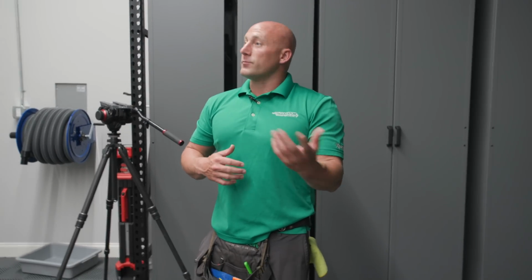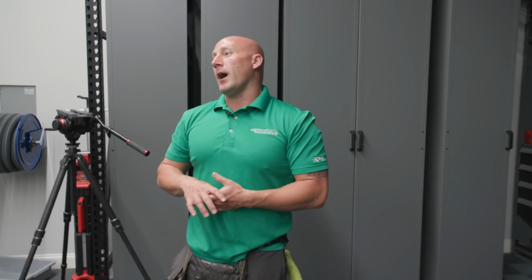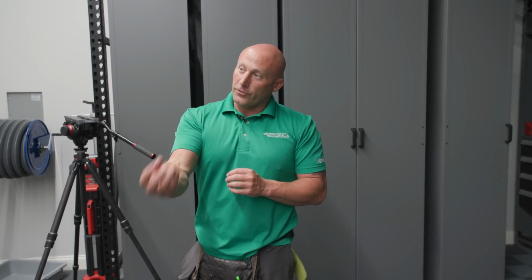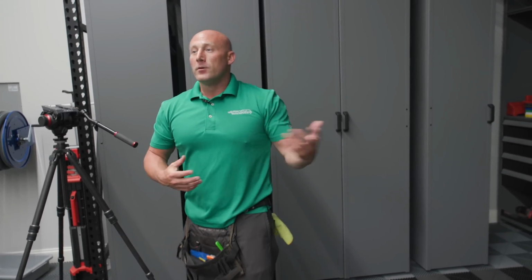XR is a ceramic film, so you still get in the 80s in heat reduction IR, in the 60s total solar. XR Plus is the ceramic film that is XR with the addition of IR reducers, which reduce even more heat. So with a thicker film, when you're looking through more technology, you're going to drop down a tick in optical clarity because you're looking through more material. So I think XR on this is going to be the call.